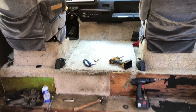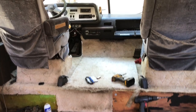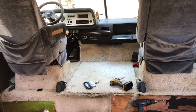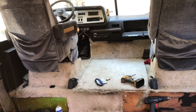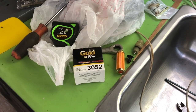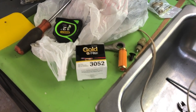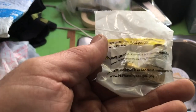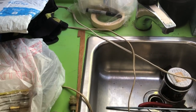We're going to change the wire to our distributor — it's going to be a direct heavy gauge wire powering that, so we're going to eliminate that. We're going to put a fuel filter in the carburetor. We're going to move the fuel line around so that it doesn't get so hot, to eliminate vapor lock. I've got a nice proper right angle adapter today. So let's see what happens.